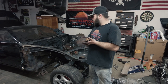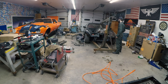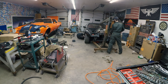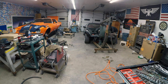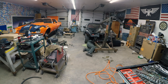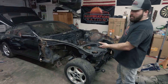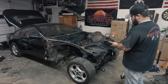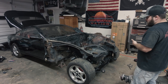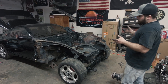After trying to fit the motor and transmission combo in together, the geometry just isn't right — you can't get the trans in to clear the steering rack with the oil pan. So we opted to drop the whole cradle assembly out. We're going to jack the chassis up in the air, attach the cradle to the engine, roll it underneath the car, and ease the car down on top of it.